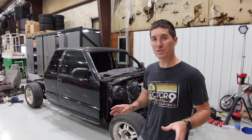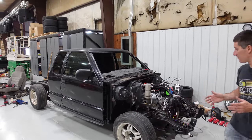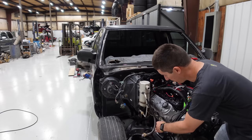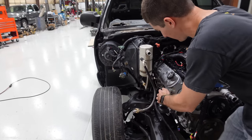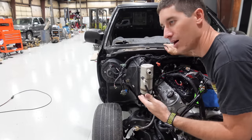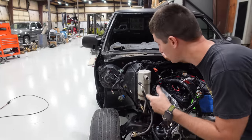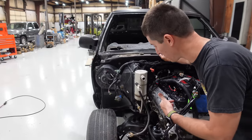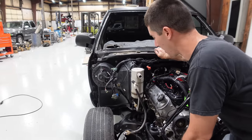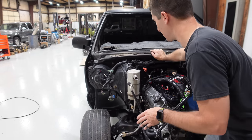You probably don't even want to do this without these things. Holley sells a full kit, and we are running Holley's full kit. That kit comes with your engine mounts, your transmission mount, and there's a cross member to swap out. The transmission moves a little bit and it lets you run true duals through this thing with Holley's cross member, which is a pretty cool setup. You probably want all of those parts.